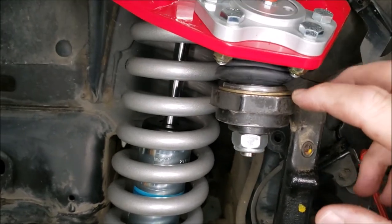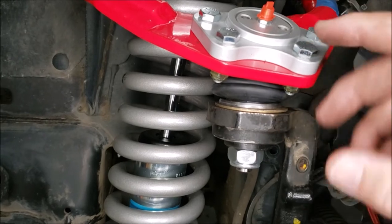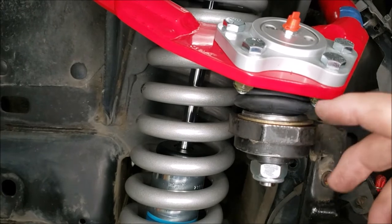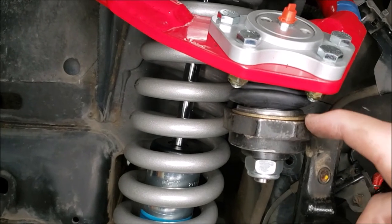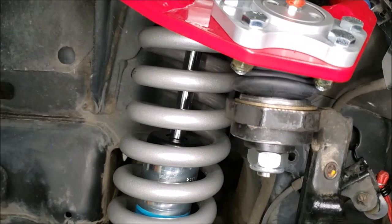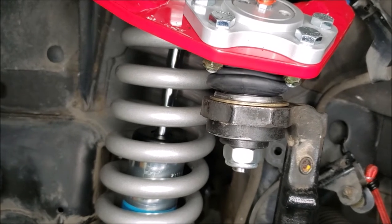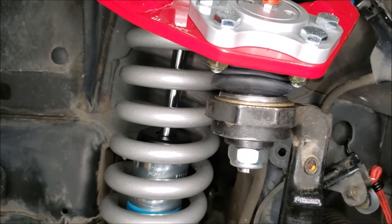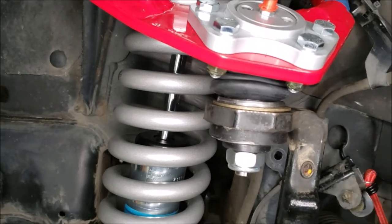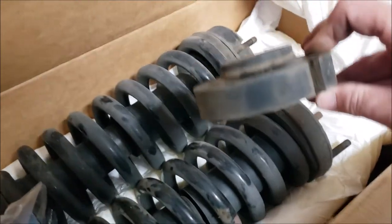You will need a press when taking the ball joint out of the spindle. The ball joint on the JBA upper A-arm is different — it points down, whereas the factory stock one points up — but regardless, you will need a press. If you don't have one, rent one from your auto parts store. Study up on how to use it, and again you're going to need a stout half-inch impact, whether electric/battery or air.